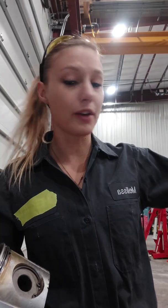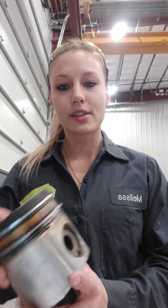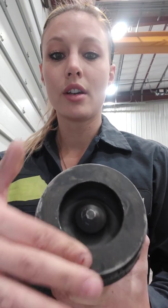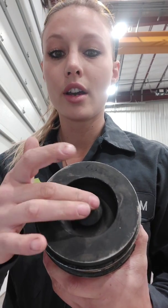To start out, I'm going to show you a healthy piston. This is out of my Cummins from when I rebuilt it. Obviously you can see it's got a lot of miles on it, but notice how the bowl is perfect — there's no indentation from valves, and the combustion chamber looks great. It's got a little heat-scorched oil right there, but all the rings are intact.